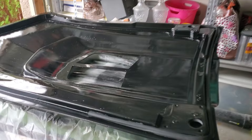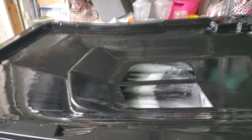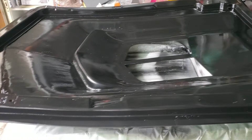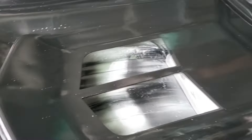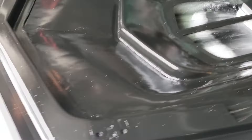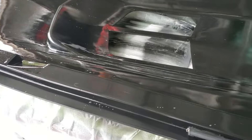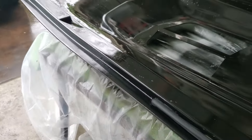I got done painting this. Like I said, it's not perfect because it's still wavy on the inside — I'm not going for perfection. I got a few water spots from when I opened up the door and sprayed the car, but I'm going to wipe that down. There are a few tiny little areas, and I am going to come back and wet sand this with 3000 grit to get all these little bumps out. You can kind of see how it has that ripple to it.